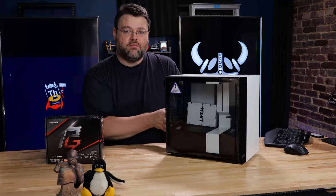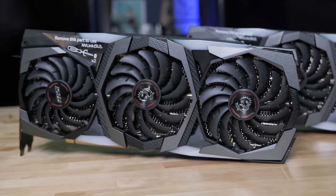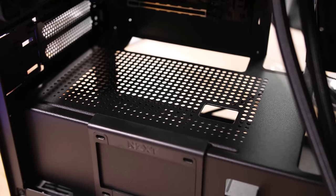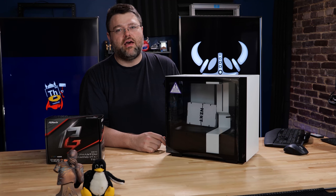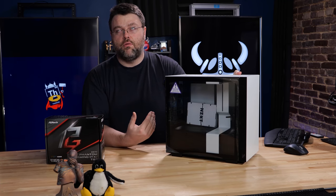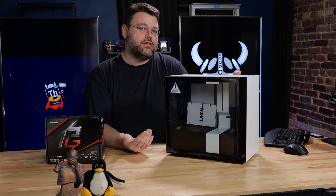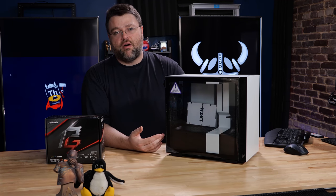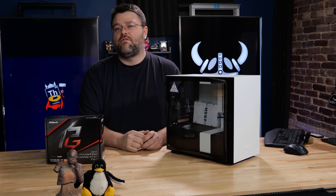This will fit ITX motherboards. It's got cutouts at the back for a dual slot configuration, but chunky cards like the MSI 2070 Super and 2080 Super will actually fit in here, though there's not really any clearance for the bottom part. The bottom part does have air holes so it can probably breathe pretty well. I did some quick impromptu testing and thermals were a little elevated, but I didn't notice any degradation of performance — I did hear the fans ramp up a bit more in this case. That's with a dual 140 millimeter intake in the front with a rad, running a 3600X CPU. Keep in mind the 3600X doesn't produce quite as much heat as a 3900X — it's anecdotal. The intake is on the bottom and the sides of the front because the front is solid, so your fans in the front really have to work to pull in air for appropriate airflow.